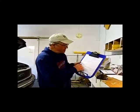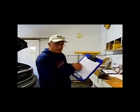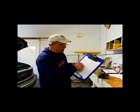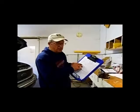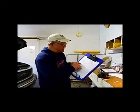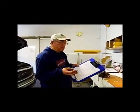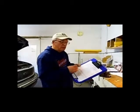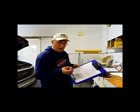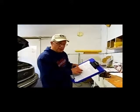Underneath it, there's an item and then a description. The first thing you're going to put here is mod, which is the modification, and then the PCV adaptation, if it has a PCV. 98% of the vehicles out there do have. So you put that down there in the price. We also have other products, like a resistor that goes into the intake air temperature circuit, and a resistor pair that goes into the post-cat O2 sensor. If you add those, then you want to put them down here.